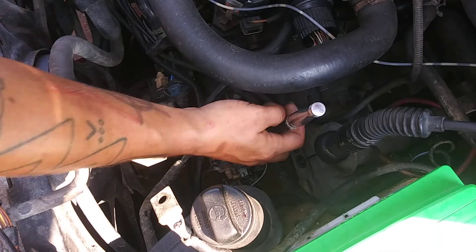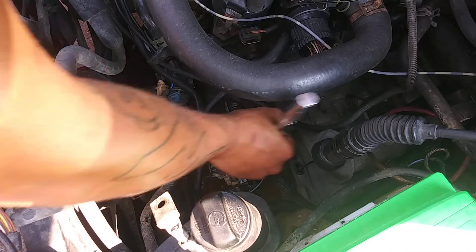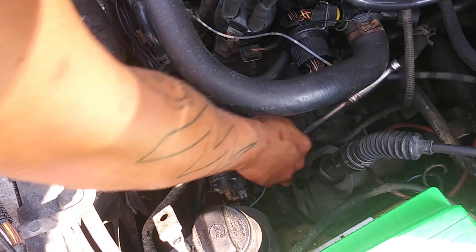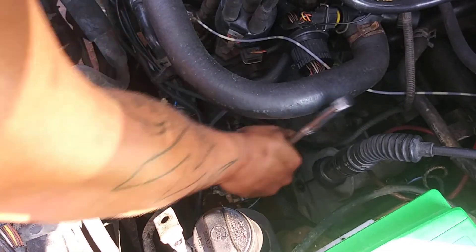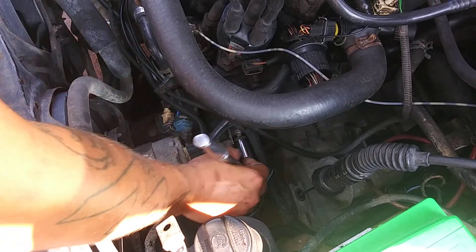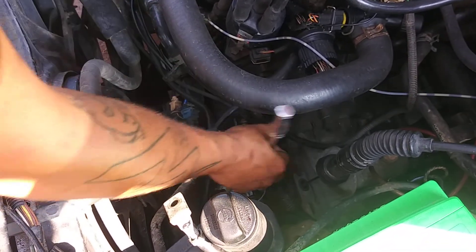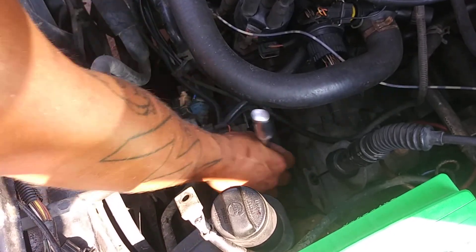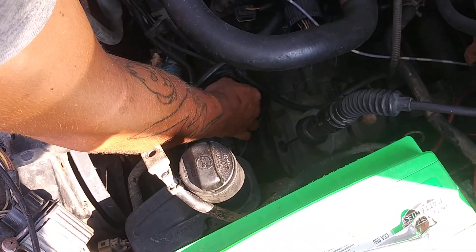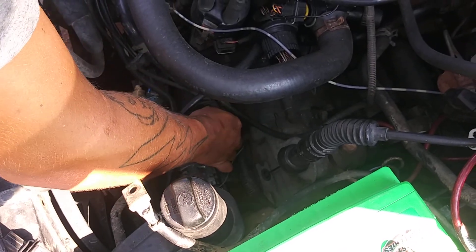You can just bust it loose and bring it right on out. Of course, if you pull the battery tray out, you can fit a little impact driver in there and this will go a lot faster. I also like doing things by hand when it's on other people's cars. It's not that I don't trust power tools — I do trust power tools, I just don't always trust myself. You can cross-thread something if you're not on it right, or if the bolt itself is seized and you go giving it too many shots trying to pull it off, you turn around and break the head off, and then you're stuck drilling things. I want this to go smooth and easy, so I just do it by hand.